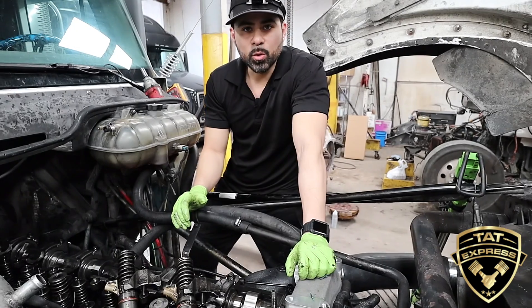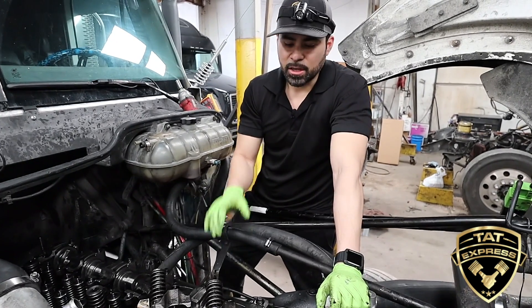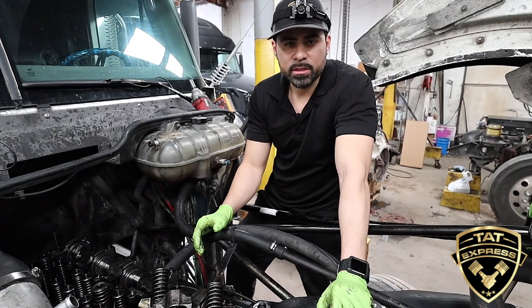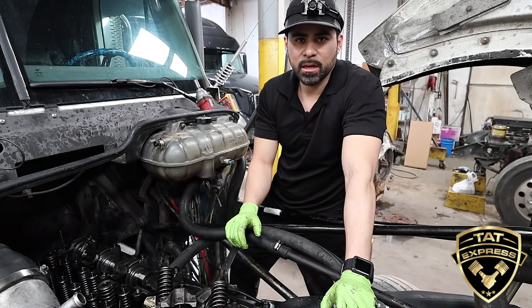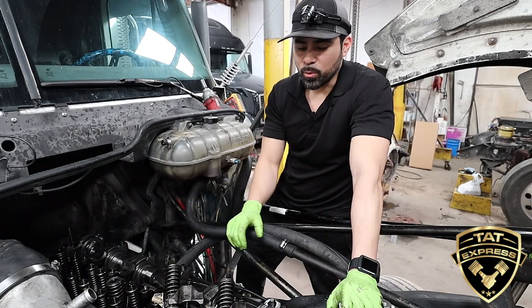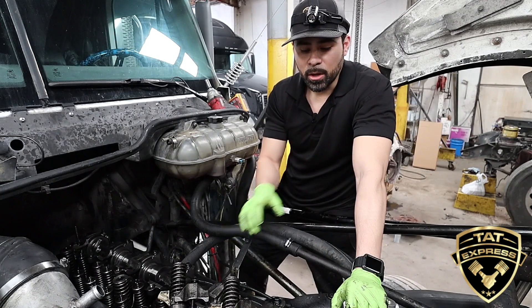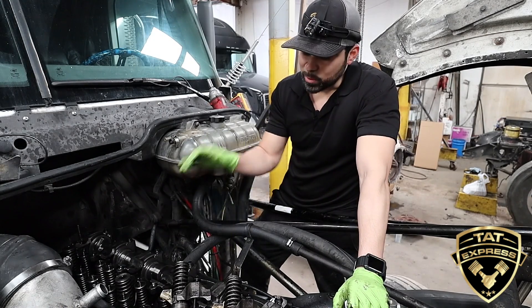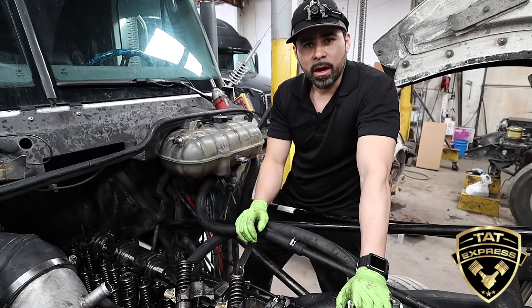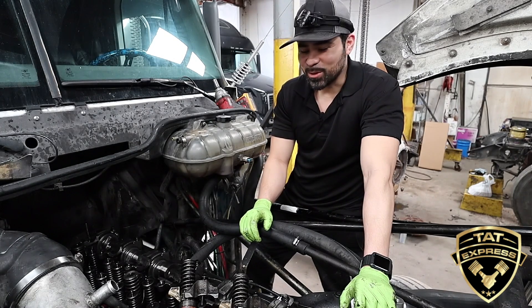This is a good test to find where you're actually losing pressure. Not all the time from an injector cutout test are you going to find this, because due to low fuel pressure into the head you're going to get erratic readings across all the injectors — so even a cutout test won't point out which injector is bad. With this particular engine we did the pressure test and this is what we found. We're going to pull the rest of the injectors, clean the injector bores, replace all the O-rings, and test it again to make sure it holds 80 PSI strong.